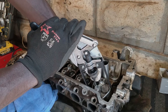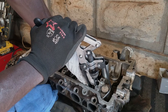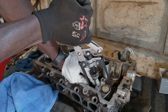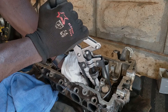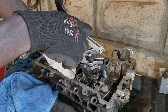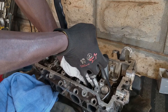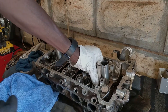Adjust the tool accordingly, then put your finger in the hole to hold the locks and push the tool in to compress the spring. Touch and feel for when the locks go into place — this is why I said put them at 12 and 6 o'clock, once you do that you'll just feel them slide in and it clicks. After that you can just hand-press the tool and play around with the valve a little bit to see that it's actually seated, and voila, that's done.